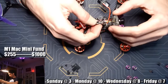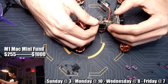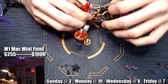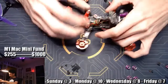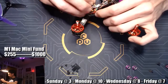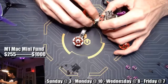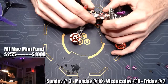Okay, so here's the situation. The ViFly trips when the flight controller is plugged into the ESC. I've double checked that the cable coming out of the ESC to the flight controller is good. Black on the outside, red right next to it, and then on the flight controller, red on the outside, black right next to it.